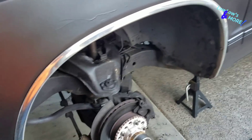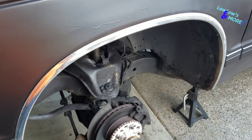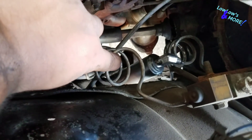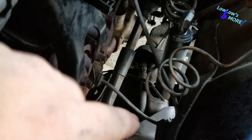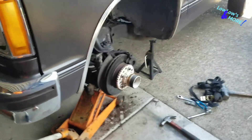I'm running late today to meet up with my club, so this is where I'm going to leave off part one for building a lowrider. I was going to run the hoses but that's pretty much self-explanatory - I'll do that in part two. If you don't have much room, like for these brake lines, you can move them out of the way - just be very careful when bending them so you don't break them, especially on the driver's side. And then reconnect your steering shaft, because on this one it was in the way of removing the A-arms. So that finishes off part one - put the wheels back on and come back another day to finish up.